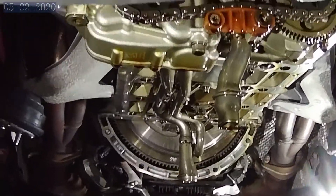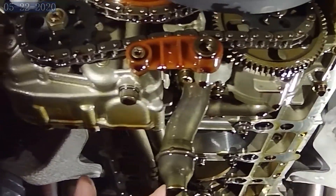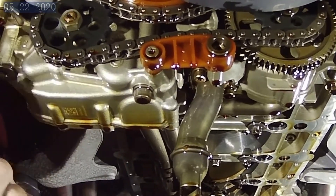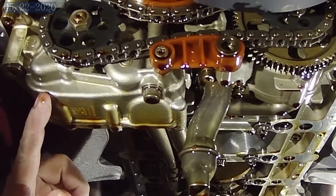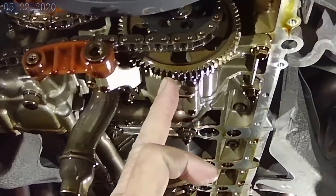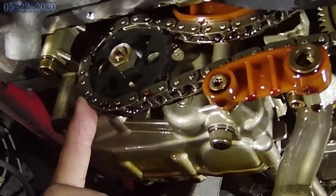We're going to pan on up here. What we see here is two pumps. This is the scavenge pump — it sucks out of here and provides oil back to the main pan. This here is the pressure pump. The scavenge pump is driven off the crank by this gear, which in turn drives this sprocket and the chain over to the pressure pump.